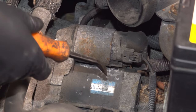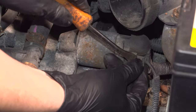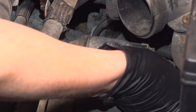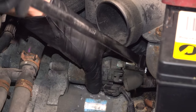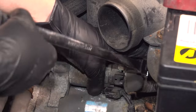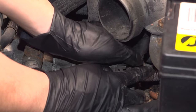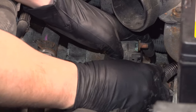There's the starter right there. I'm going to start by disconnecting the signal wire, which is this small one here. I'm pressing on the connector and then going to help it come off with a little pry bar — sometimes these get stuck in here. Once you take that off, if you peel this boot back, you'll see the main power wire. That is a 12 millimeter mounting nut, so let's grab a socket or a wrench and take that off. Break this free — this shouldn't be very tight, although sometimes it does get stuck. Once you unthread it a little bit, you should be able to just pull it off. Try not to lose that. Now you can take the main power wire off and set it aside.